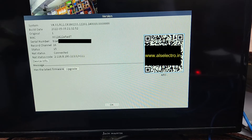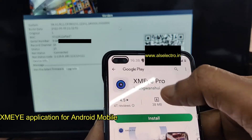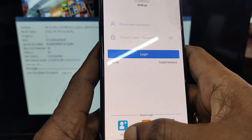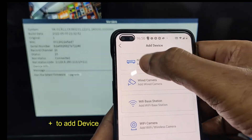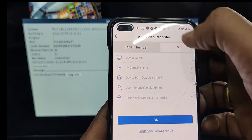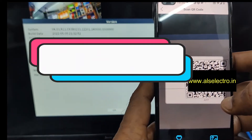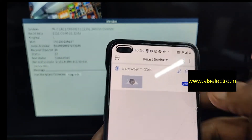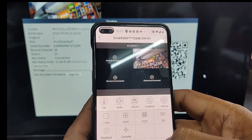For the mobile app, go to Advanced and click on Version. Here you can see the serial number and a QR code. Using your Android mobile, scan the QR code — it will take you to the XMEye app installation. Install XMEye and open it. Touch Local at the bottom left corner, then touch Add Device (plus symbol), select NVR, and choose the serial number tab. Scan the QR code again — the serial number and password will be automatically read into the application. Open the device and you can see the cameras connected. Touch on a camera to view it on your mobile from anywhere in the world.